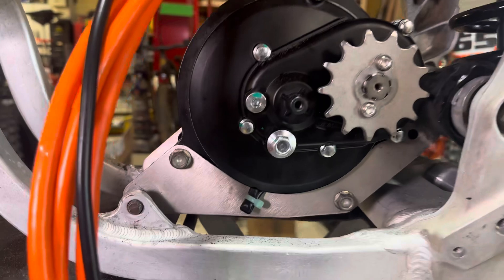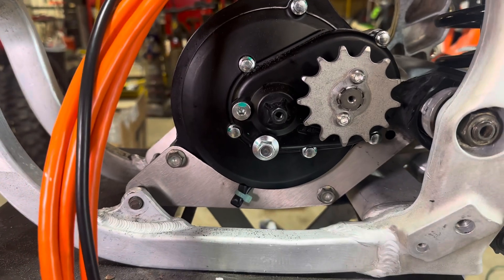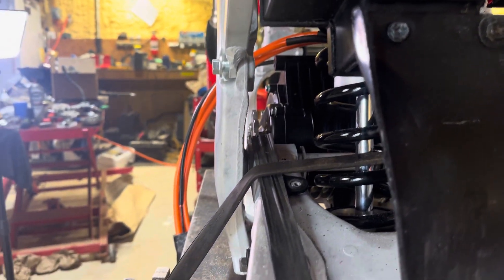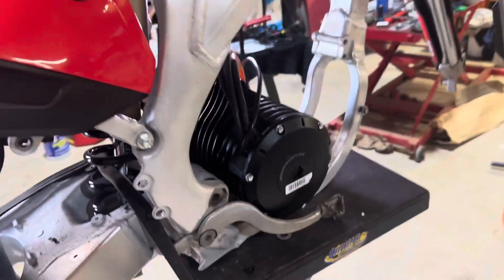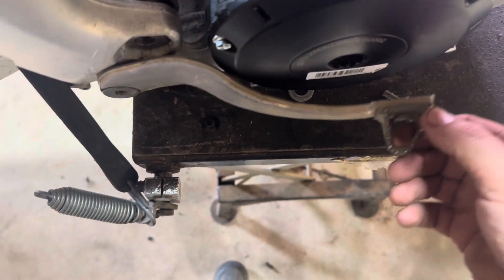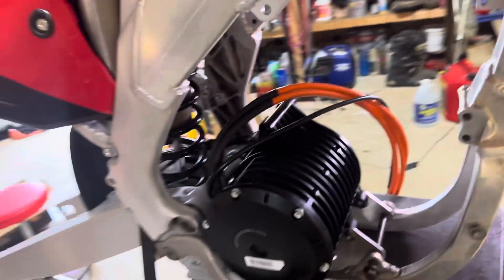Using the mounts, we've got a couple of the bolts holding them in there. I've got one more bolt here — it's going to be a longer bolt to be able to put in there. Put the chain guide in where it goes just so I can see if it's lined up properly. We'll put the wheel on and make for sure. And then on this side, we have all the room in the world clearing this rear brake. The mock test fit-up does work.